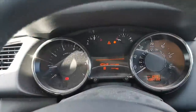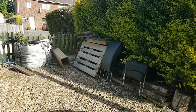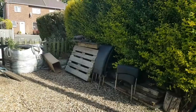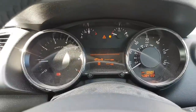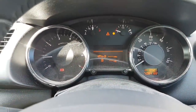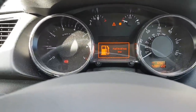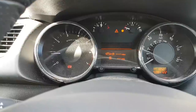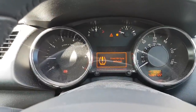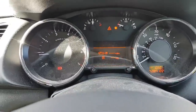Second gear, third gear — the turbo spools straight away. Third, fourth, fifth, sixth gear, then a cruise. Absolutely perfect. Conclusion: a blocked catalytic converter. I'd love to cut open the old cat to show you the inside — but the owner wants it back. After more camera inspection that cat is completely clogged, with only a few ceramic cells open. It could potentially be cleaned, but replacement was the quickest and safest solution.